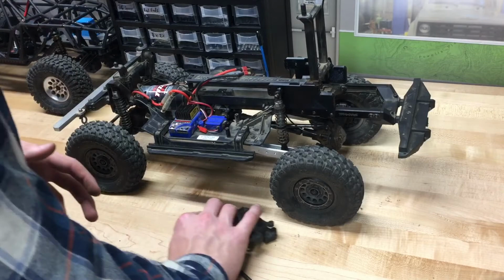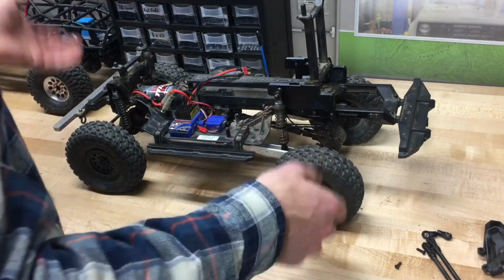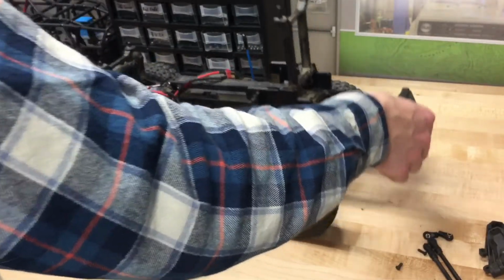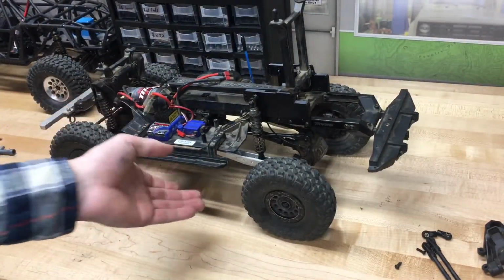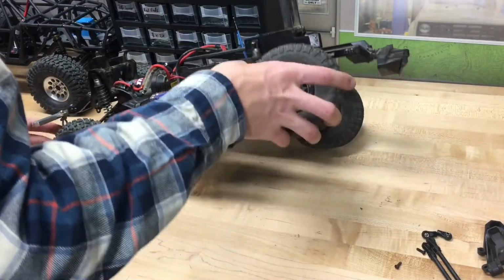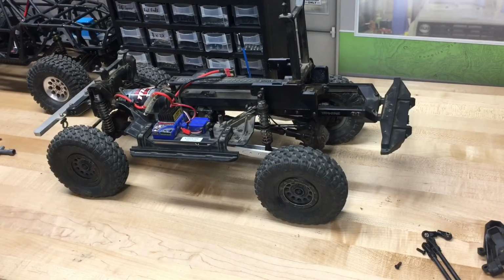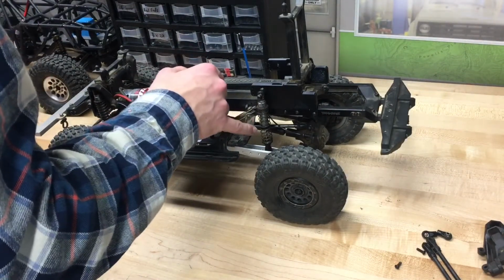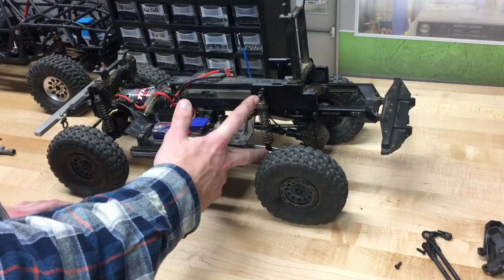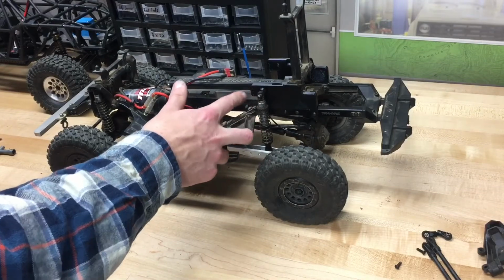So, now we can talk about the benefits of running a trailing arm suspension. Basically what this does is allow you increased suspension travel out of a factory length shock. At the mounting positions I have, it's really nothing dramatic, but it will still give you increased suspension travel, flexibility, all those things that people like to look for. You'll definitely need to do some minor trimming here, or along with this 12.8 wheelbase, you could mount the shock even further forward, or mount this shock in this position here.